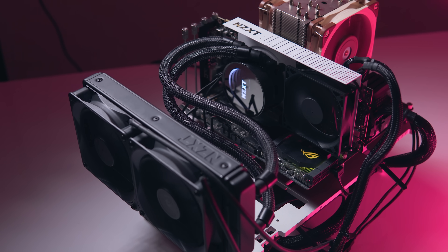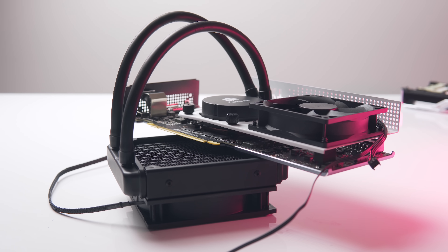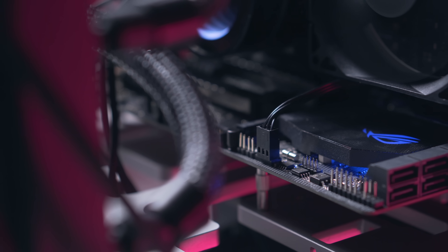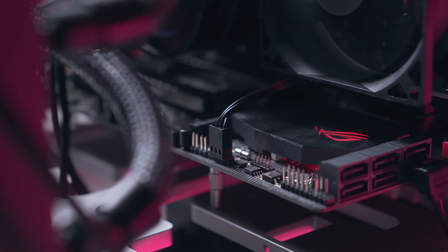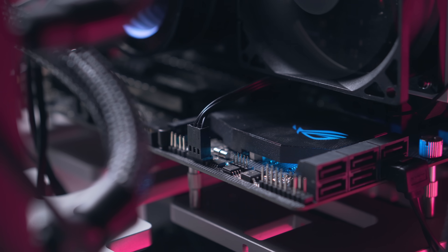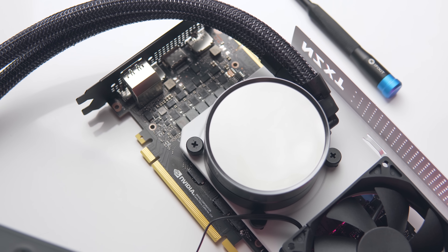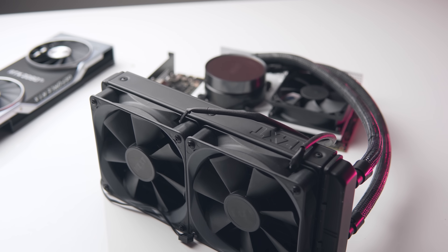This isn't a problem with most other cards — when I did the same mod for my 1080 Ti last year, I could get by with just a mini 4-pin adapter to connect the fans to the GPU. For the new RTX Founders Edition cards though, you'll have to plug both the radiator fans and the VRM fan directly into your motherboard's chassis fan headers. This means fan speed will be controlled via CPU temp instead of GPU temp, so you'll need to do some playing around in the BIOS to make sure those fans are tuned appropriately while gaming. For testing, I've set the fan speed for the hybrid kits to 1350 RPM — a quiet but still effective speed that represents real-world use.